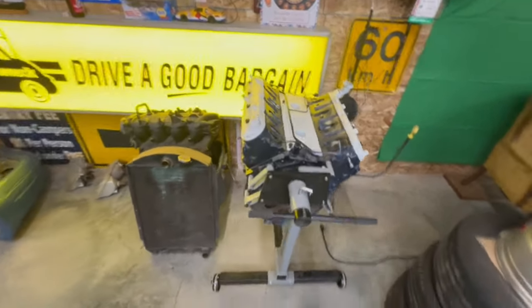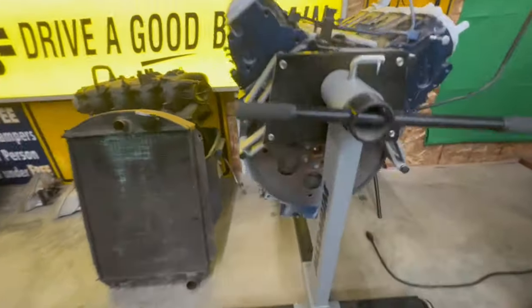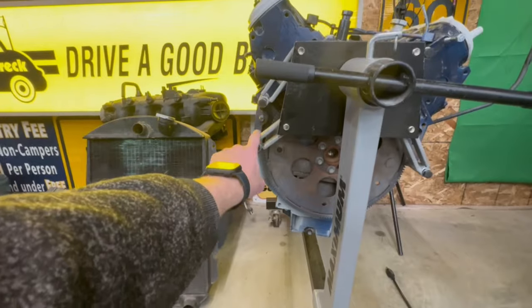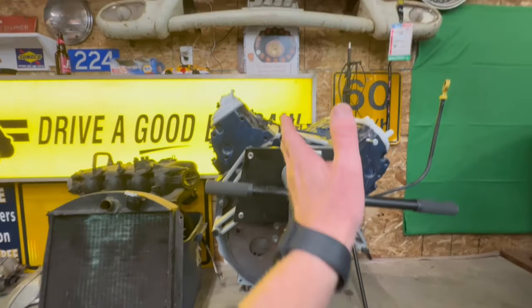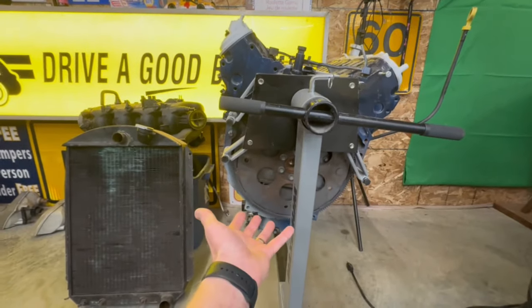The first thing we've got to do is get the engine crane back out and lift the weight off this engine, because too much of the engine is sitting below the pivot point and I can't flip it over. They've got these arms all the way down, so we're going to loosen everything up, get it in the air, readjust, flip it over to take the base pan off and get to those crank bolts.